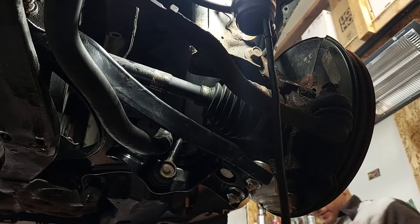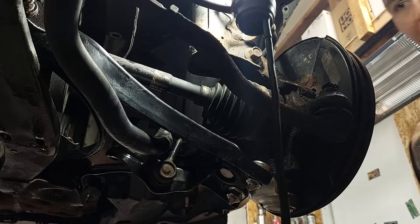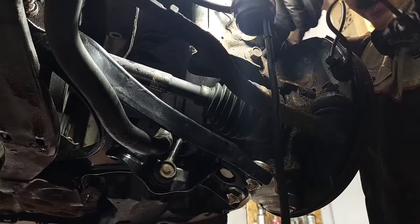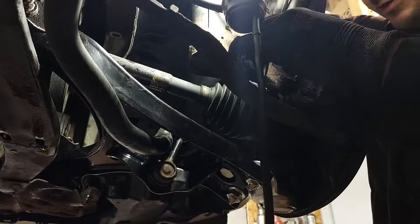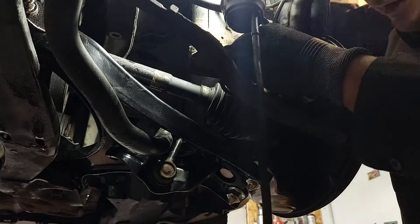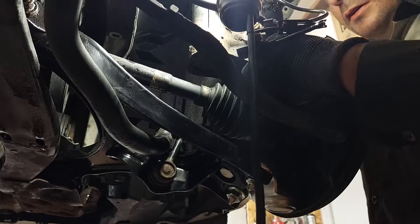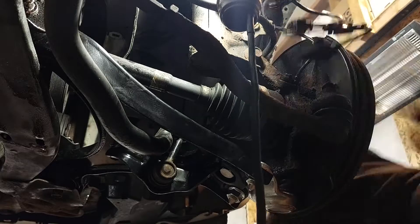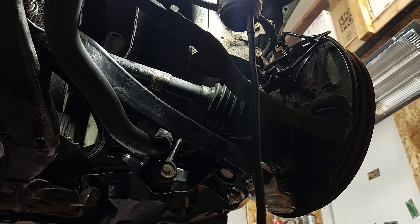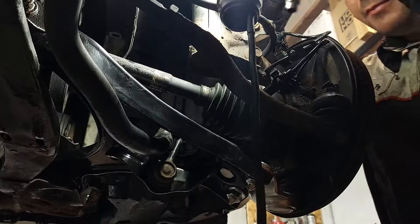What I like to do is get a little bit of grease and just grease around the shaft — not the part that picks up the signal. I already blew out the hole. We're going to put this in here. If it doesn't fix the problem, the customer has to pay for diagnostics. I'm not here to throw parts at a car because the customer doesn't want to pay for diagnostics. We'll tighten this down. Someone was in here — obviously the customer isn't being transparent.